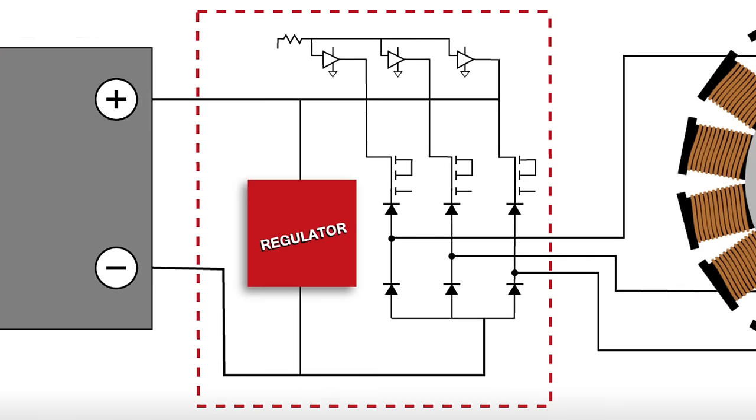Let's look at this next drawing. Well, is this the circuit that I'm sure is inside this particular unit? No, I can't tell you that. But I think I can explain what's going on. Once again, it was very easy to forward bias these three diodes going back to the battery. Now look what happens when you try to forward bias these back from ground.